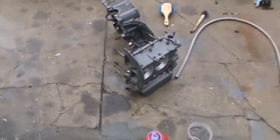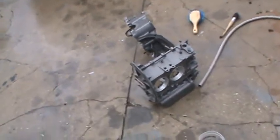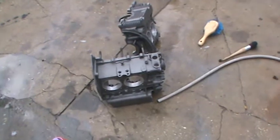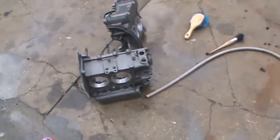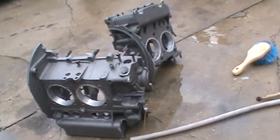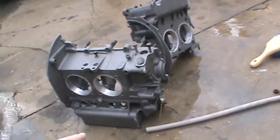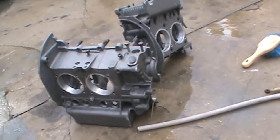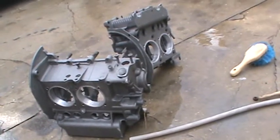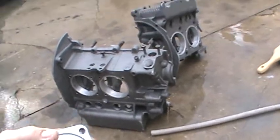I need to call Ken and find out about the flywheel. He's out picking up some spring washers and hardware — I've depleted all my stuff. Hardware is a choice: new or used. If you buy a rebuilt motor from me it always has brand new hardware. After bolts have been used for 25-30 years, it's time to replace them so you get a proper torque reading. You want the proper and correct spring washer so the bolts torque up the way they're designed to. You can't take a split washer and put it where a spring washer was — that just doesn't work out that way.